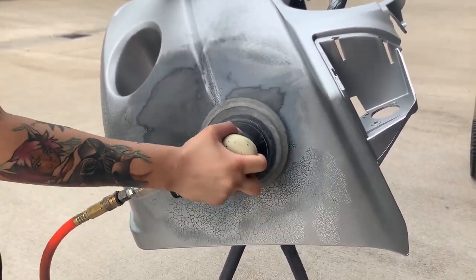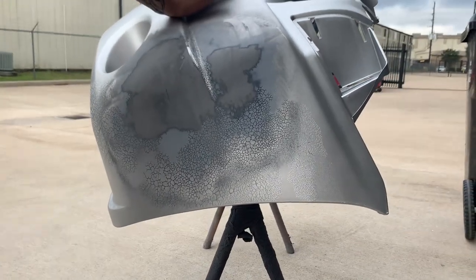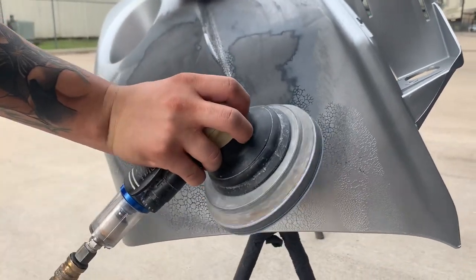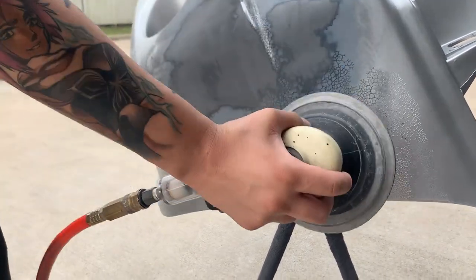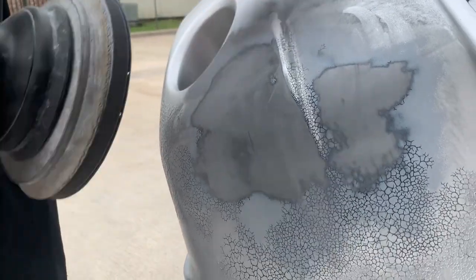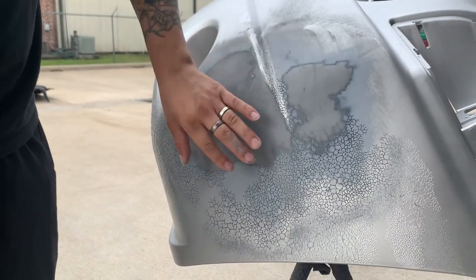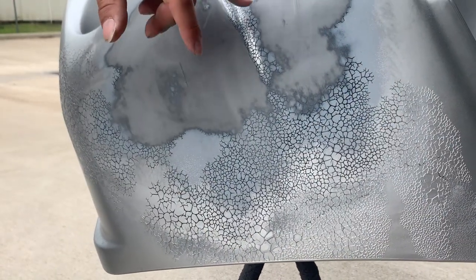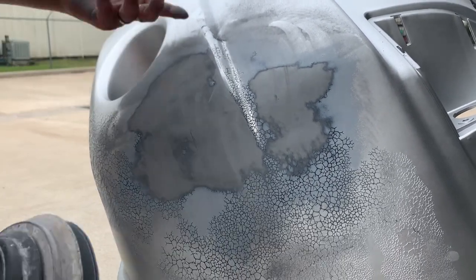You can do a crisscross motion or a circular motion — it ultimately just depends on who's doing it. The only thing you don't want to do is go on too much of an incline, because you don't want to dig too deep and damage the actual bumper. Keep the pad flat. It's a little difficult on these curves, so I might actually have to do those by hand, or go on a slight incline and be very gentle so I don't accidentally burn the edge clean off. I'll do circular or crisscross motions here, and then switch to hand sanding with a 380 or 320 on the curves.